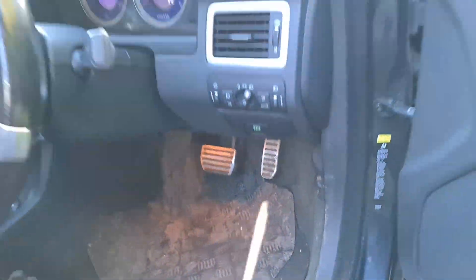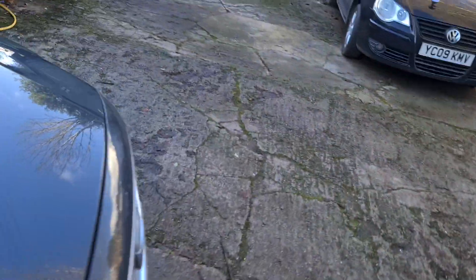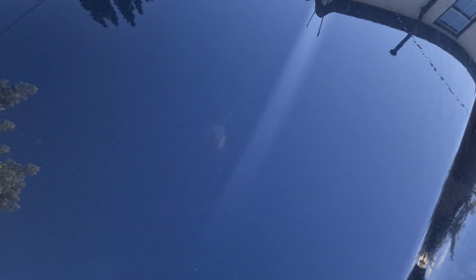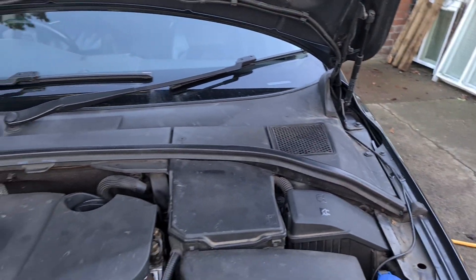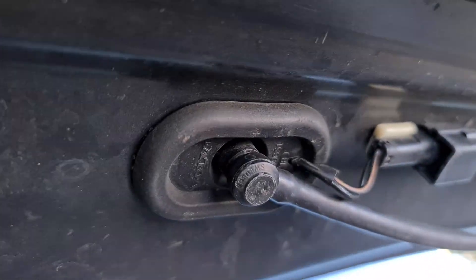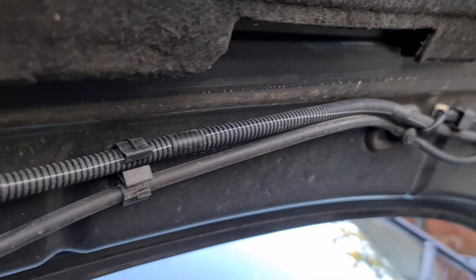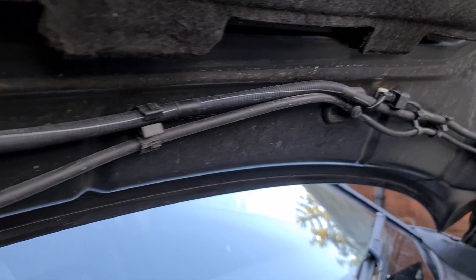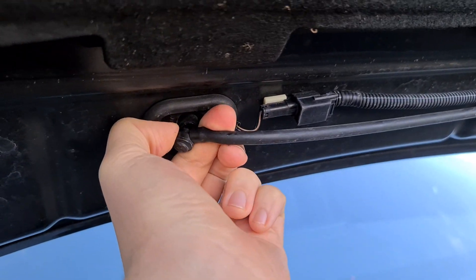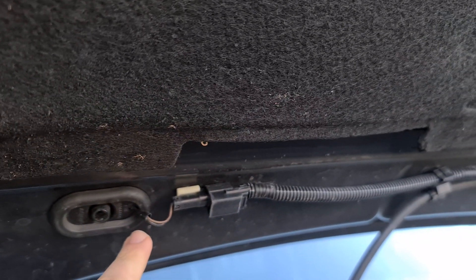Let's get into how to fix it — first of all just need to pop the bonnet. Now that the bonnet has popped, we'll lift it. There we go. The two pipes we want to remove are this one here and this one here — they're all part of the same pipe as you can see. They're fairly easy to remove, just pull them. Be careful not to snap anything. What you don't want to pull is this, because this is your heated nozzles as part of the winter pack.